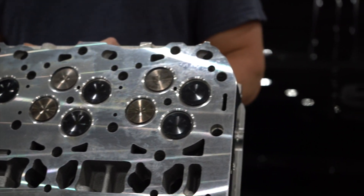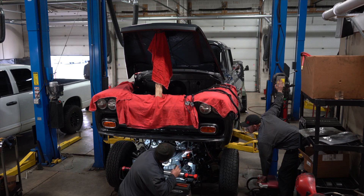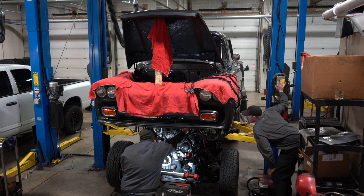The question from here is how does it translate to the truck, the dyno, and the performance of the vehicle — and that's what we aim to find out. The only thing we're going to change on the Apache for this test is the cylinder heads. We're not going to change anything to the fuel system or the turbocharger. Just a strict A-B test. In order to gain access to the cylinder heads on the Apache, we pull the body off and just work on the heads right there on the chassis, which makes for an easy swap.